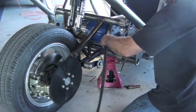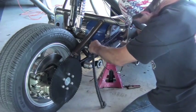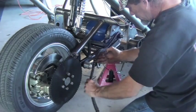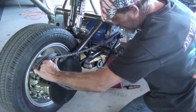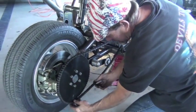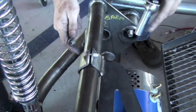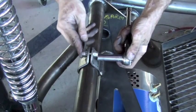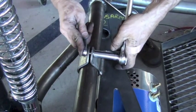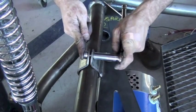With our sprockets aligned, we can put the chain on. We're going to start with the motor sprocket — put the chain on the motor sprocket and then on the drive wheel sprocket, and make sure the chain routes itself over the tensioner, which is the small sprocket in the center. With our chain alignment complete, we want to tighten the brackets that hold the subassembly to the swing arm so that we can adjust the tension on our chain — that's the next step in our sequence.